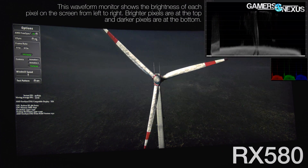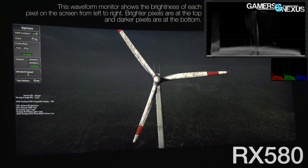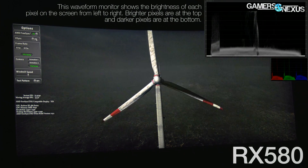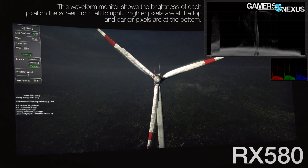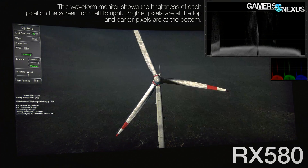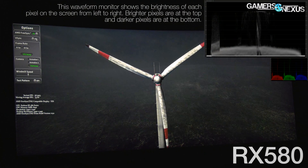With the flickering, we can reproduce it here. You're not going to see as much on camera because of the filming setup, but we have B-roll of it flickering. That flickering is produced on an RX 580 and can be reproduced with the oldest and newest drivers available for the RX 580 — no problem whatsoever. We can get it to flicker so severely that if you were going to buy this monitor and you had a 580, I would tell you absolutely do not do it. It's not a good FreeSync experience with a 580 with the drivers we've tested.